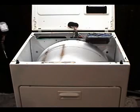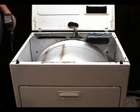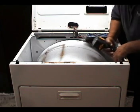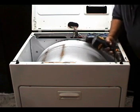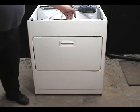To be able to remove the front panel, you need to remove these two screws. Go ahead and remove the screw on the left, then the screw on the right. Be careful with the sharp edges on the front panel.